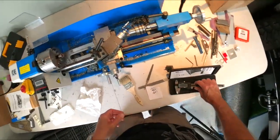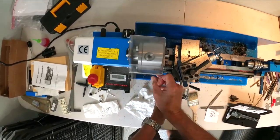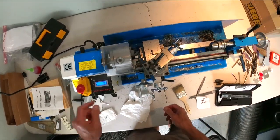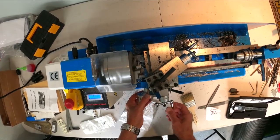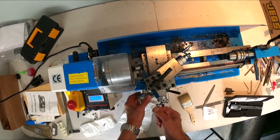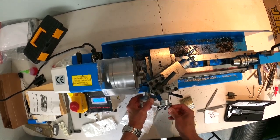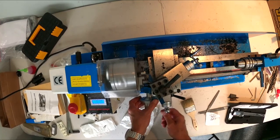So I'm at 485. So we're going to have a few cuts in here. Yeah, it's got a switch on here. So we'll back it off a hair. We'll touch it off. I do just a 1/16 of a turn and then start working it in. So you can see the chips coming off. You get nice little 3-4 inch chips. Back it off.